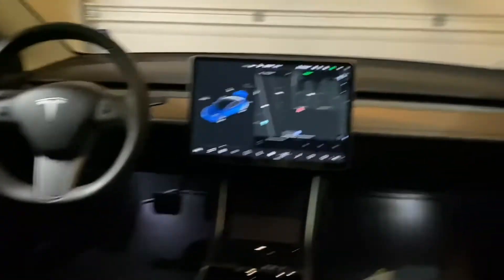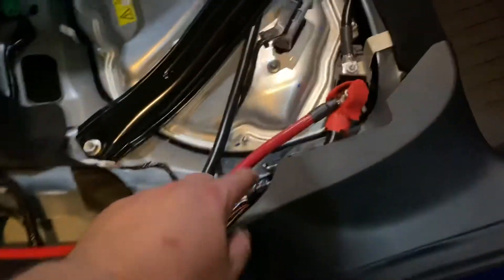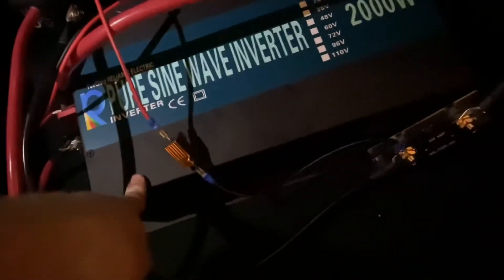Hopefully this works and we'll be able to have 2,000 watts of power for when another power outage hits. The car looks fine, I'm fine. You can see I've run this big heavy-duty 1/0 cable — these go behind the panel, hard to see, which routes to the amplifier for the subwoofer. I punched holes through here which go to this inverter, and I have a relay set up with a resistor to slow the charge on the capacitors so they won't overload the system. Got my fuse here.